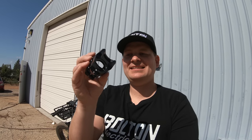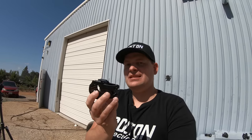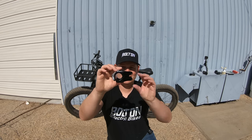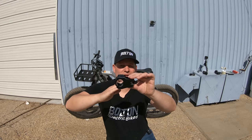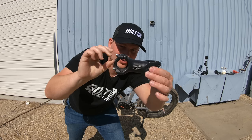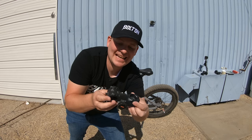For the custom bike I'm working on, I wanted the bars to be nice and close so the bike was fairly comfortable and maneuverable, but I didn't want them terribly high because that might affect the aesthetics. That leads to number two: stems have different angles. This stem is what you'd call zero degrees — there's no rise from where the stem mounts onto your fork to the hole where the handlebars go. Something like what comes on the Warthog might have a small rise of maybe six degrees or so, which is a common number.